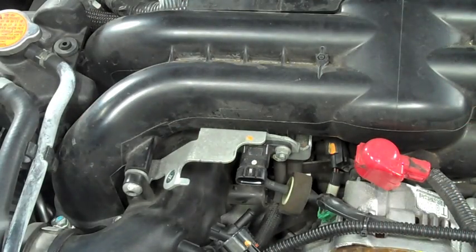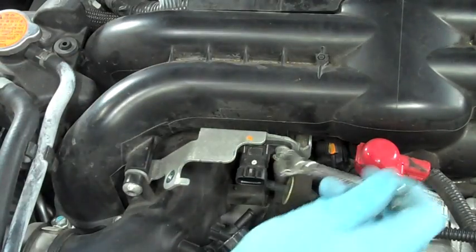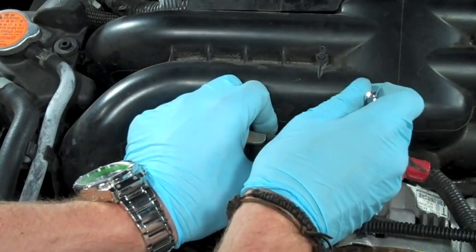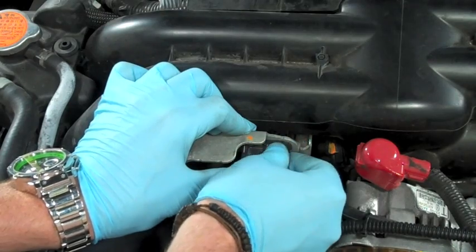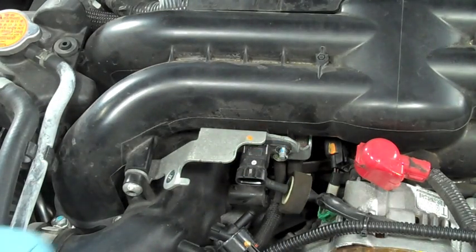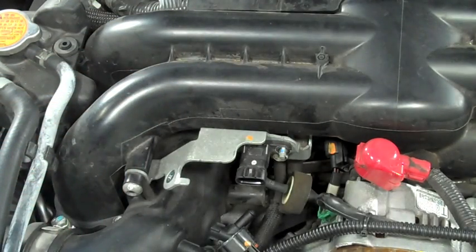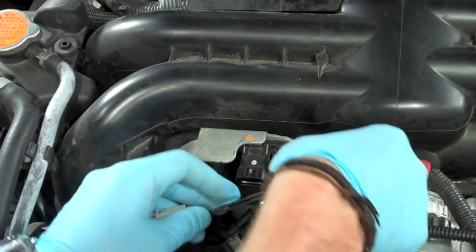For the LGT, the setup is a little different. We're going to take our 10mm wrench and unscrew the nut on the other sensor connected to the OEM BCS bracket. You will not need to remove or move the sensor at all. The LGT bracket, as you see here, is black and shaped a little differently — it goes right on top. The reason it's shaped differently and mounted in a different location is so that it sits underneath the engine cover.